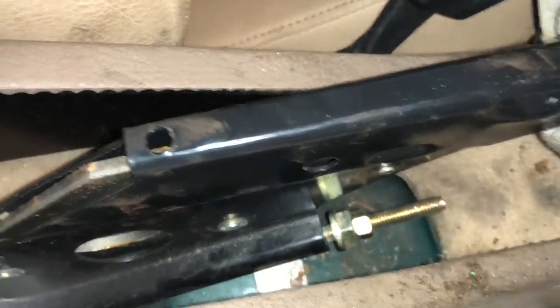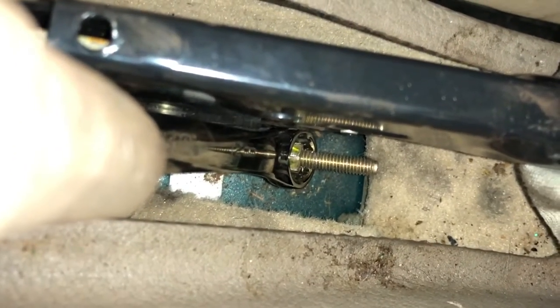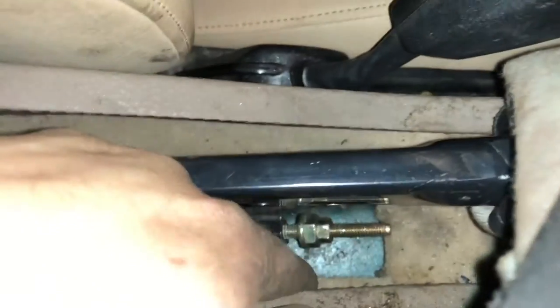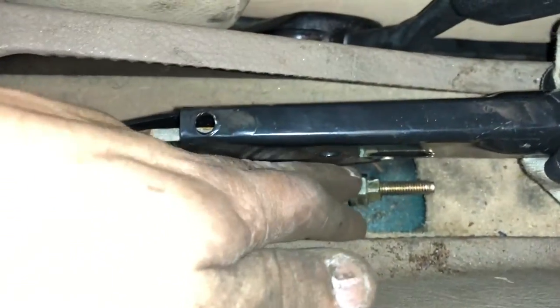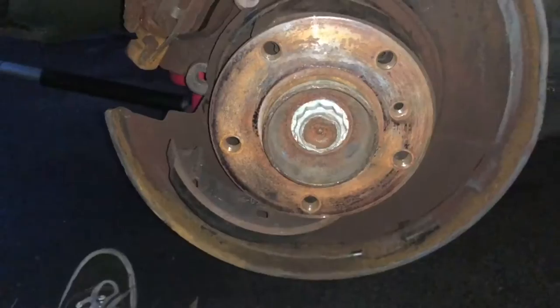You'll have access to the two parking brake lines that go to either side. You want to loosen up both bolts and extend them all the way out. The best way I found is to use a 12mm for the back nut, then slide a deep 9mm socket over the front nut to loosen it. Once you break those loose, extend them all the way to the front — that gives you more line to push through. Leave the nut on the end so the line doesn't get pulled all the way through.